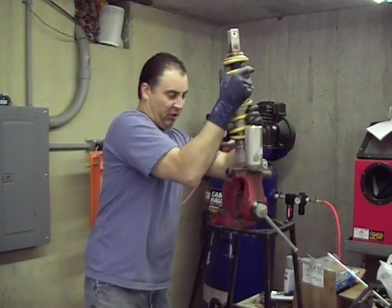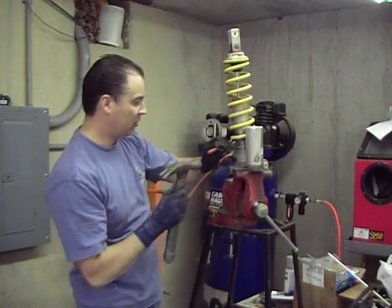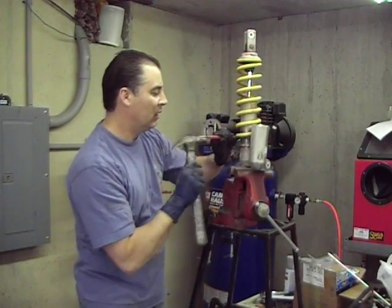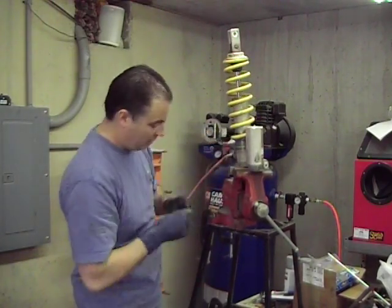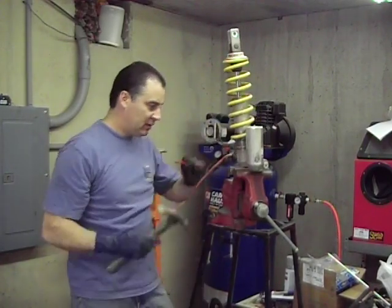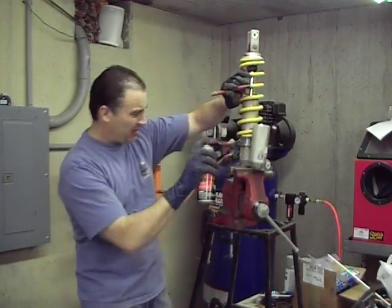The spring collar can come off. If it gets too tight, coax it along with a little drift. The tough part is once the spring starts to loosen its grip, the spring will twist but the collar doesn't twist as much. Would you grab me some brake cleaner and clean these threads a little bit? These threads are kind of dirty.